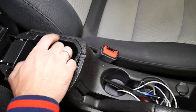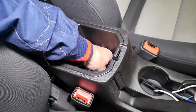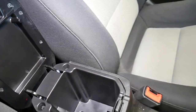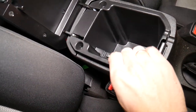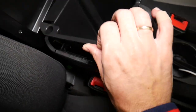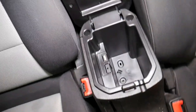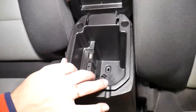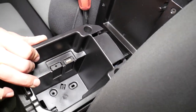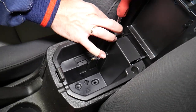Removing this one now — let me grab those screws and pull them out so they're not in the way. Now we're going to lift that thing up, but you cannot pull it out because we have the cables for the USB and auxiliary port. Right here in the back, you lift it up and there are two more screws that we need to remove.